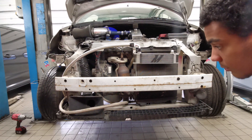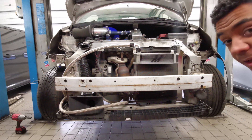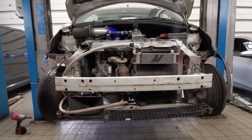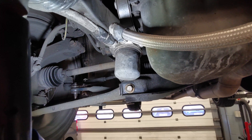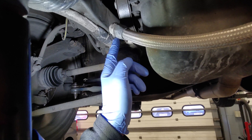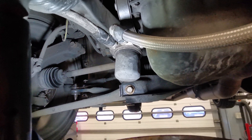I forgot to bring the thermostat with me, and I also can't fit the thermostat yet anyway because I don't have enough hoses to do that. But I do have enough length in these braided hoses to complete the system, so that's what I'm going to do today. Here we have the sandwich plate — looking a bit dirty because I don't have any under trays on this car, and I did have to take the wheel arch liners out for the wide body. I'm going to be disconnecting this hose, and that side will be attached to the sandwich plate, and then the hose connected to the other side of the cooler will be going in there. I'll put a drainer underneath to catch any fluid that spills out.